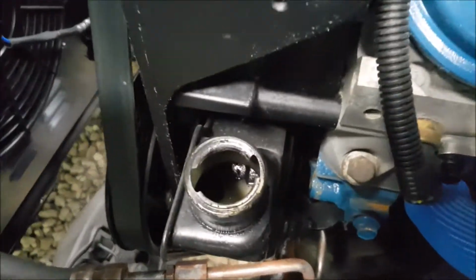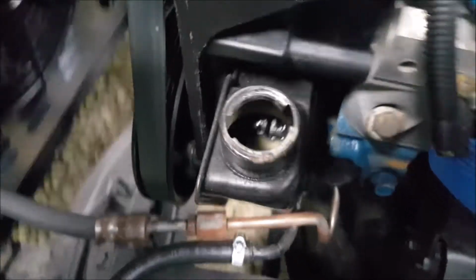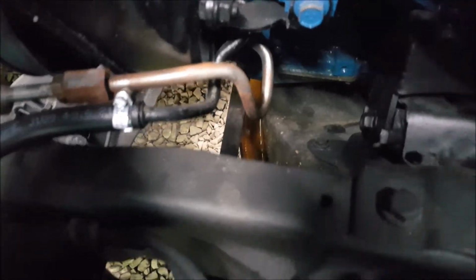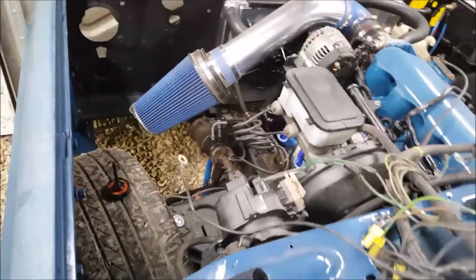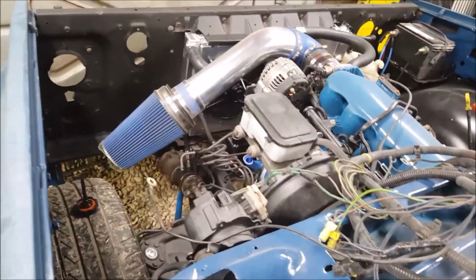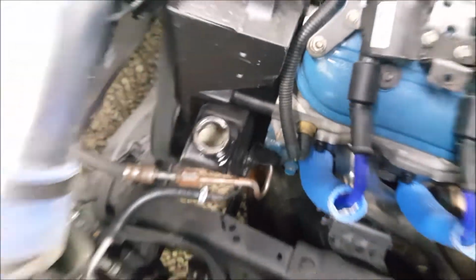Well, found out why it's real hard to turn. I guess it just didn't have enough in there. Man, I'm pretty sure that's water down there. Need to clean it off though, but definitely need to put some fluid in it. Oh yeah, 2 fingers, man, 2 fingers. Yep, just really low on power steering fluid. Still kind of low, but good enough now.